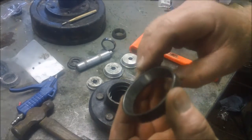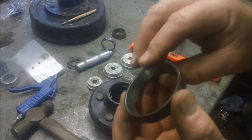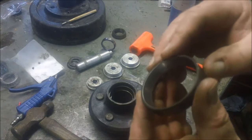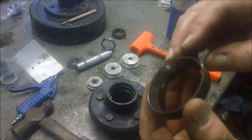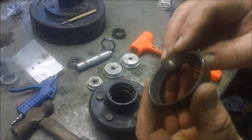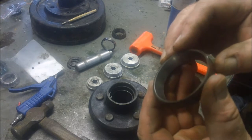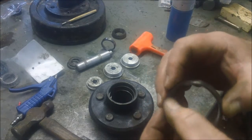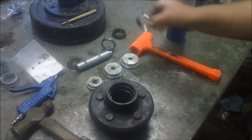You see those vertical lines? That's the beginnings of pitting into the case hardening. And I know there's people out there who say it'll wear back in. In my humble opinion, when you get to that point, get rid of them, because it's just going to promote flaking of the case hardening off these things, you know.